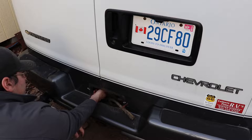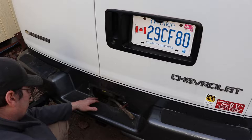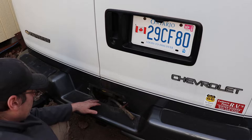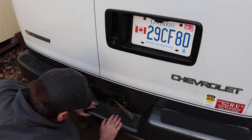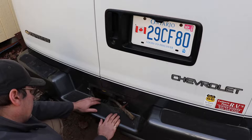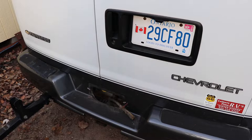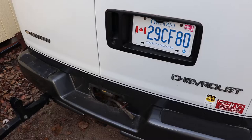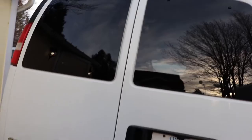Some places require a five or ten year inspection on the propane tank, some don't, so you're pretty much on your own to get them inspected. This one hasn't been inspected and tagged since it was built in 2004 — quite a long time. There's a gauge to tell you how much propane is in the tank; it's frosted over, which is something I need to look at replacing. Then there's a valve, and you look at the tank to verify there are no giant rust spots on it. Check your sticker on the plate, and check all of your lights.